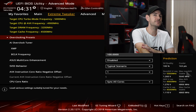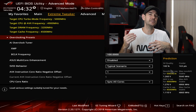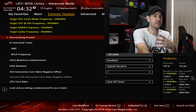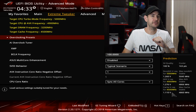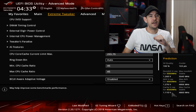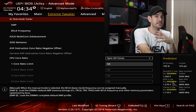We also have cooler points here as well. What it does is it actually logs your temperatures as you use the computer — so as you're doing your benchmarking, gaming, and things like that — it measures how efficiently the CPU is being cooled and awards these points based off that. Then it uses these points to calculate how it predicts you'll be able to overclock the CPU based on the cooling available. For example, for a non-AVX 5GHz clock frequency we're going to need about 1.26 volts on the V-Core. For AVX at 4.9GHz with my negative offset, it's saying we'll need 1.276 volts. And for a cache frequency of 4.5GHz, it's saying I'll need about 1.11 volts to be stable. So that's a pretty cool little tool to at least get you started with overclocking.